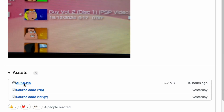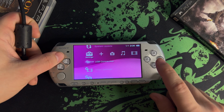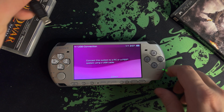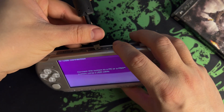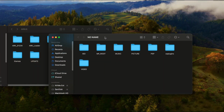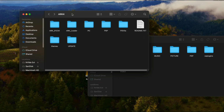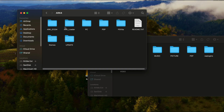Make sure you unzip the downloaded archive, and now we connect the PSP to the computer, and once again from the PSP main menu I go to USB transfer and I connect the PSP to the computer, or you can use a memory card reader. Okay, here I have both my memory card open and the ARK4 zip we downloaded. You need to extract the archive. Down in the description is a link to 7-zip application if you can't unzip it and are using Windows.